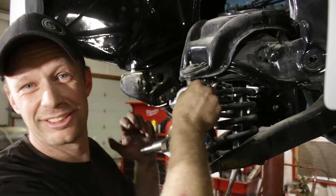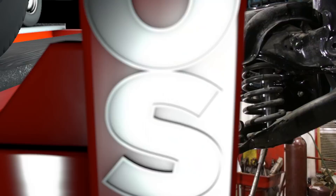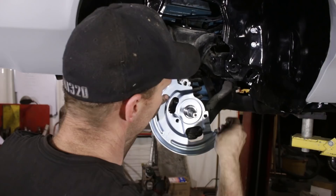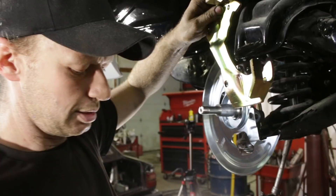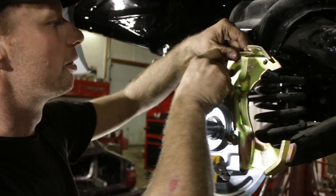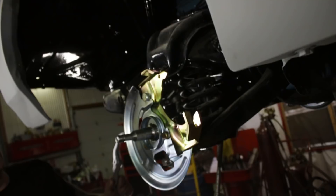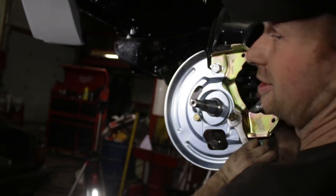I'm going to put the cotter pin in the easy way now because I don't care about future threads. You want to be able to turn with nice full motion — we are good to go. Now we're going to start with the backing plate. There is a left and a right to the backing plate, so you want to make sure the opening is towards the back for the caliper. Hold it in place with the top nut and leave the two on the bottom out for now. It comes with nice locking nuts and grade 8 bolts. Did you know that 19mm is the same size as three-quarter inch? Learn something new every day.